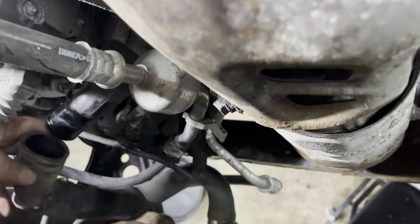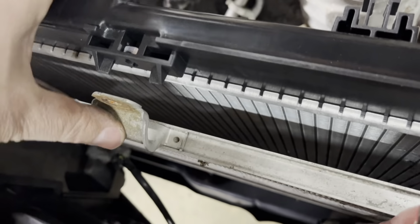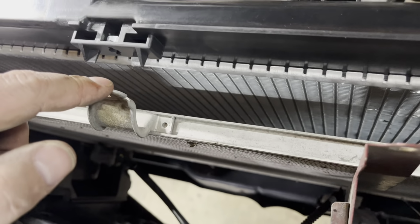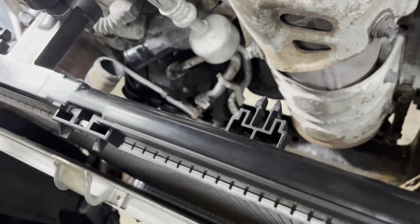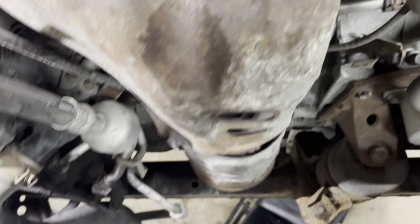So I'm gonna connect that hose. I'm also going to screw the condenser in place. I went down, you saw the plastic shards on the old condenser tabs. I actually cut those off. Honestly, I used that oscillating tool, came off pretty easy. So I'll show you as I'm reassembling, but it should be the reverse of what we did.